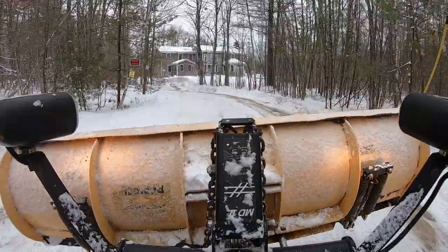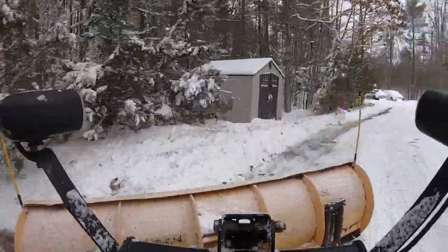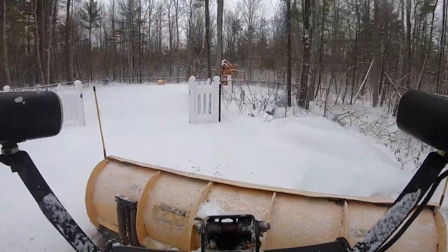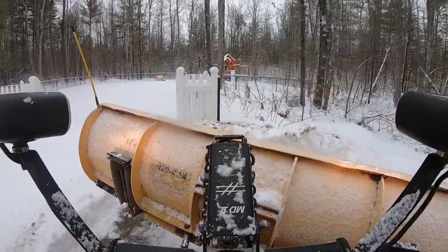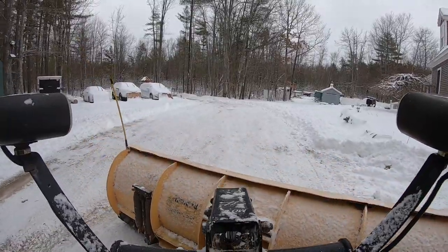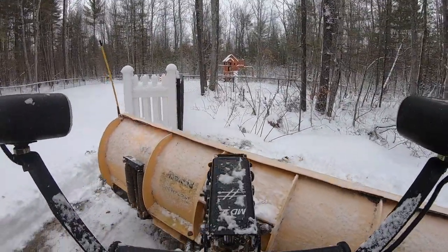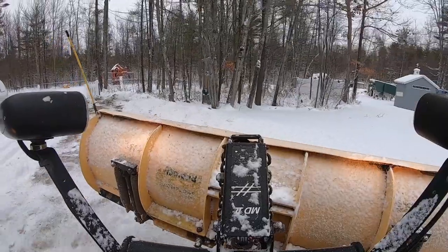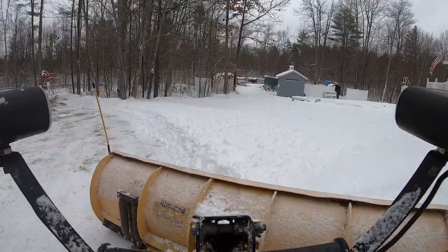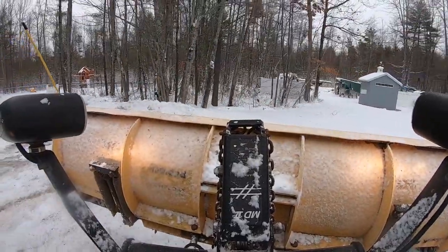Here's a view from going up the driveway. Our plow is down, angled to the left, pushing that snow as far as it'll go next to the trees. Now we're crossing over and doing the part we haven't gotten to yet. Once I crossed over lanes, I transitioned the snow plow so I wouldn't leave a snail trail. Plow is angled to the right — I go about two-thirds of the plow width in. If you go more than that you'll generally get a snail trail on the left side. Using two-thirds, keeping it angled right, then straighten out and push it off the ledge — no trail at all.